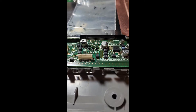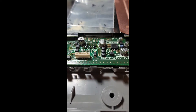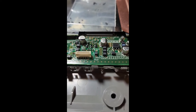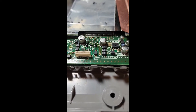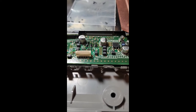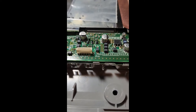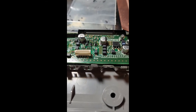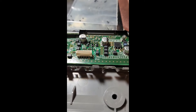If you take these off the board and test them, you should get an open line reading if you have your positive lead on the negative side — the negative side will have the gray stripe on it. On the old originals I took off, I was getting about 35 mega-ohms, which is quite a bit — that's damn near open line.